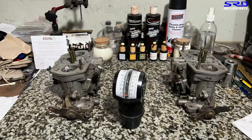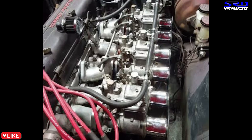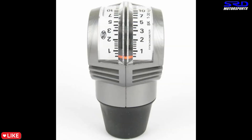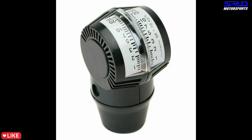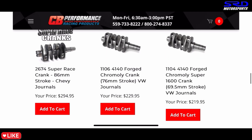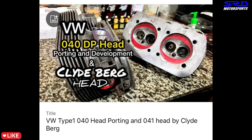On the Redline page it's actually called the synchronizing screw, so you adjust it there. Even on the 240Z Fairlady — if you run three Webers you gotta synchronize all of them. On the Kadron, you can adjust the mixture screw and also use an adapter because it's bigger. You can find the synchronizer tool on eBay or any VW shop like CB Performance — probably less than a hundred dollars. I also have a CB Performance stroker crank for my Bug, so sooner or later we'll build a two-liter VW and do a video on the heads.